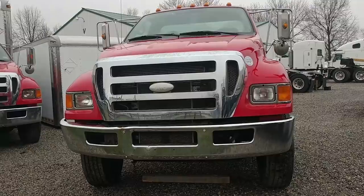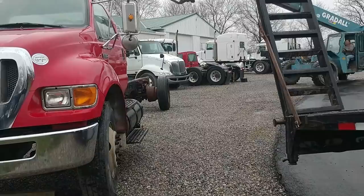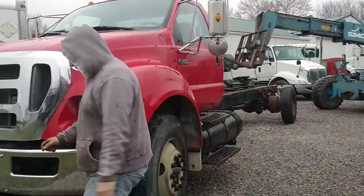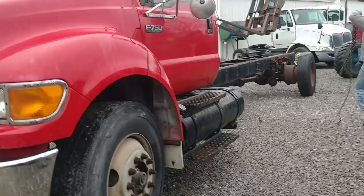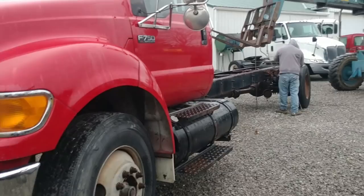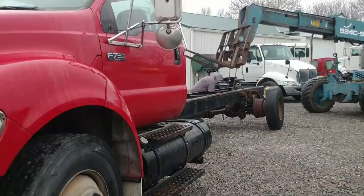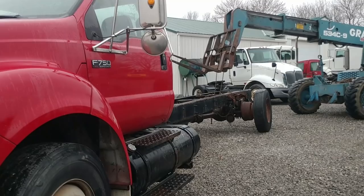We're going to take it in the shop. The problem with this truck is it had a fire in the rear brake on the driver's side, so if you look here, you'll be able to see that driver's side drum is really rusty. What happened was the brakes hung up, it got hot enough to melt or burn the seal for the hub, and the oil for the differential came out. It caught on fire and caught the box floor — which was wood — on fire. It got hot enough that from the center to the rear leaf spring hanger it bowed the frame. You can actually see it if you look close — there's a sag in the back of the frame.